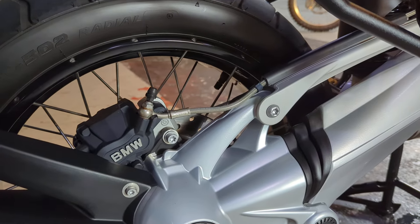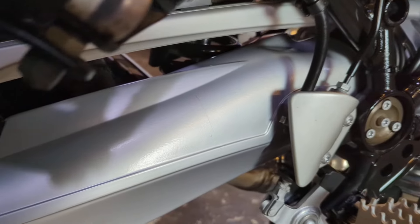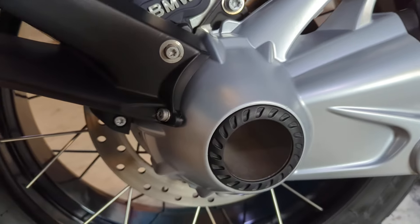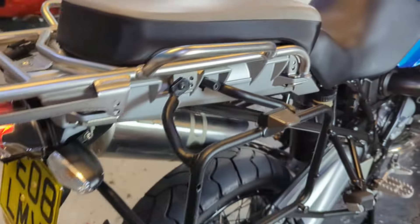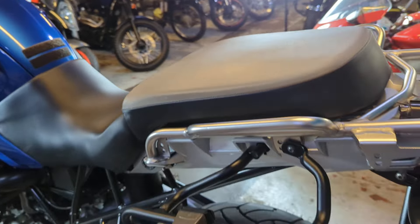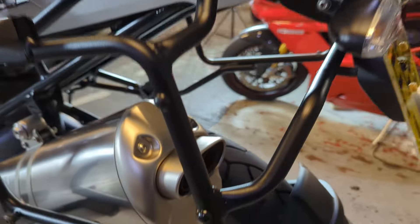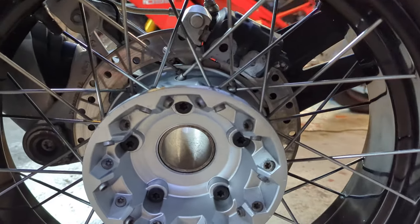Next thing, check the shaft - always check the shaft. If your shaft is nice and smooth without any knobbly bits on it, it's a good shaft. No corrosion. Look at the wheels, look at the tyres. It's got a service history, this bike - it's not full, probably been done on mileage rather than age. And it last saw BMW about 300 miles ago, so that was a full big service, or a 12K service anyway.